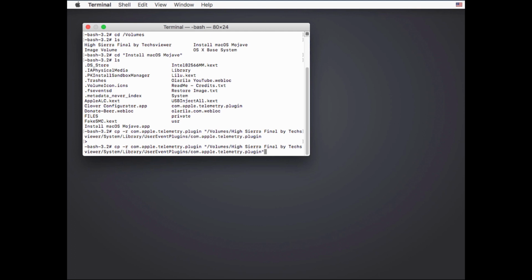Now remember, this is only for SSE 4.1 supported processors, so if it doesn't support SSE 4 at all, you're out of luck, and if it does support 4.2, this isn't going to fix similar issues. You're best to find why it's crashing.